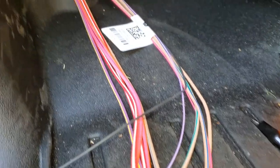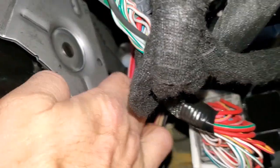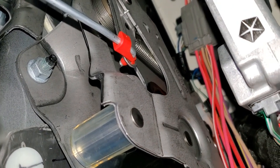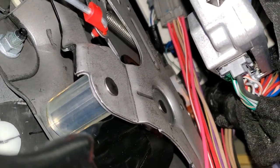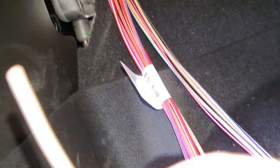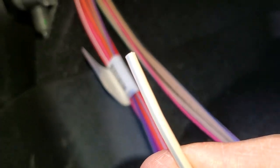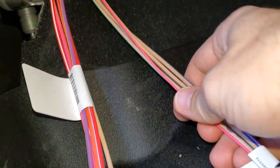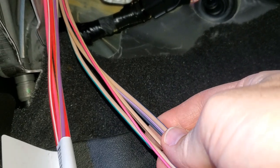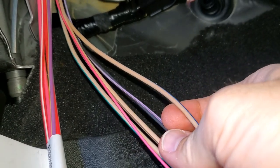So I just got both my auxiliary wiring harnesses plugged in. The gray one goes up here — it plugs in right there. This one has the pass-through looped wires that go to make the tailgate wires hot, as well as this beige with a gray stripe wire. That is the additional pass-through that wasn't there on prior years — this is first for 2021. This is the second bundle, which has the additional pass-through wires that go to the under-hood blunt cut wires as well as the PTO wires.